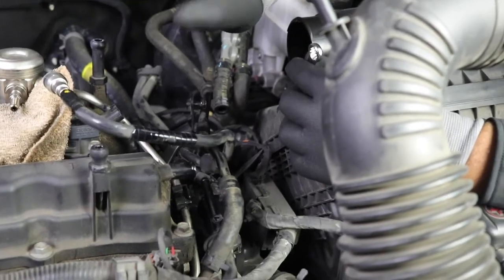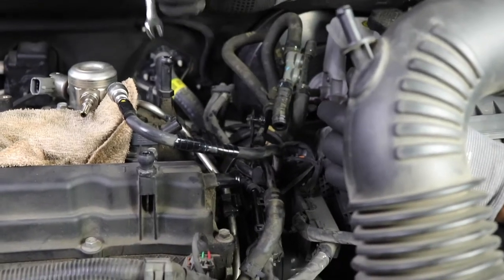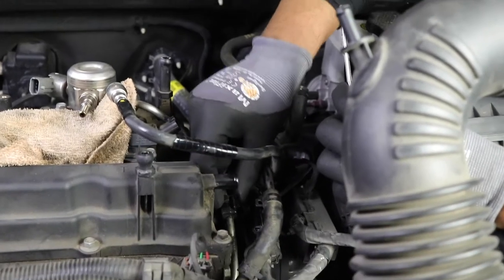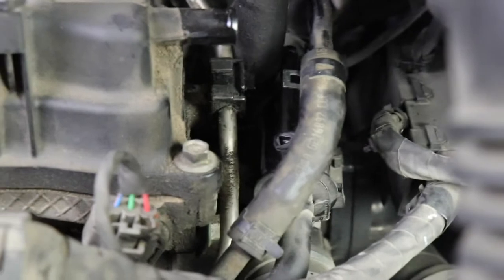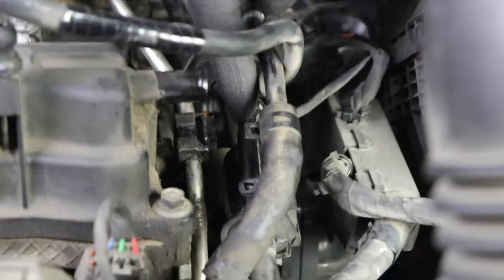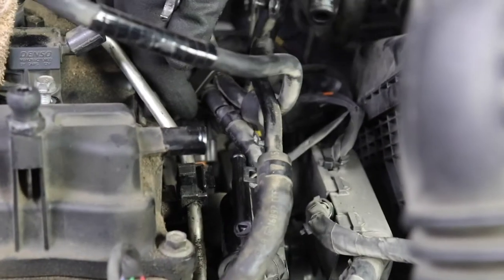Okay, so this is why you will see the rating for this whole job at the end of this video, my Carl's Garage rating. I had to use this little 10 millimeter wrench in order to get this. See, now it's loose. This stupid little bracket has a 10 millimeter bolt underneath it, same as these, holding this in, keeping it extremely tight. And I had to remove this. So you see, I had to take this hose off of here, take that off of there. I had to remove this nut down here, all to get enough looseness so that I can hold this back,